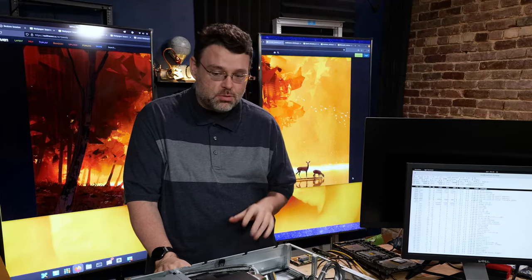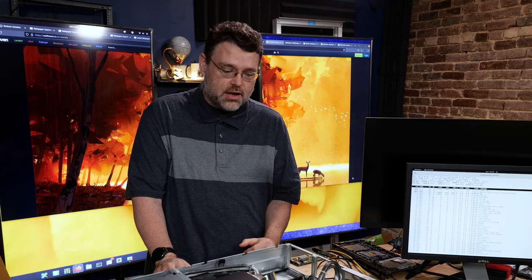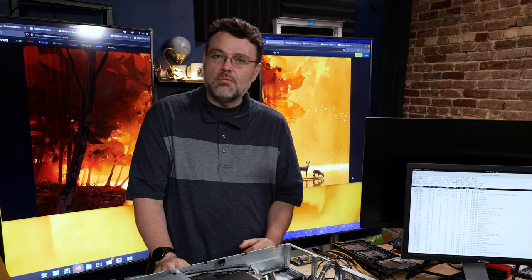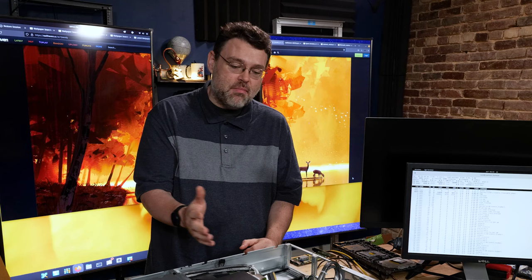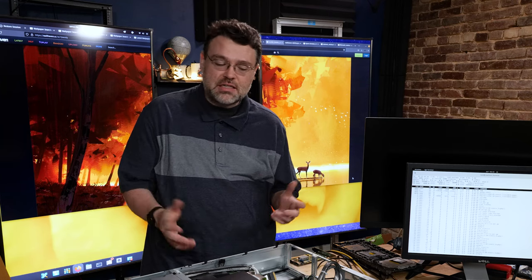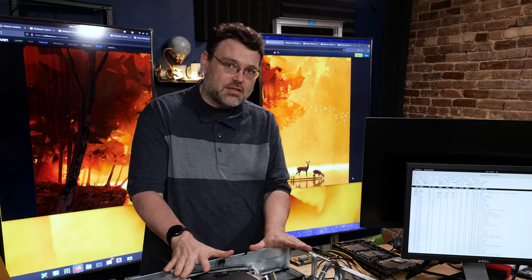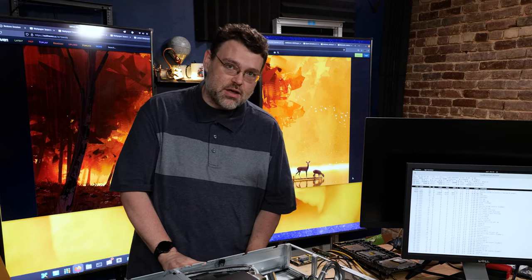But still, I've deployed a lot of these systems, and I'm genuinely surprised. I need to go back and revisit some things because I wasn't expecting to be able to run DDR5 4800 two DIMMs per channel. I mean, it is all perfectly matched. All the DIMMs were from the same lot. So maybe that's a best case scenario, but I really cannot overstate the engineering that Tyan has done in order to be able to deliver this level of stability, a DDR5 4800.